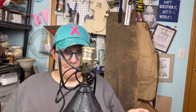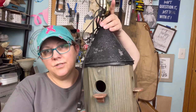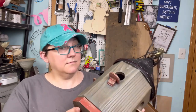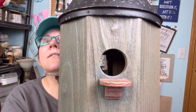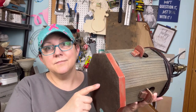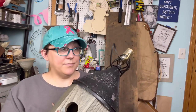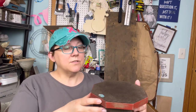Working on the lamp today! I picked this bad boy up at a garage sale for a dollar. If you're new here and haven't seen what I'm doing, the base is coming off. The seller said I could just glue it back on, but there's a threaded rod that runs through the middle of this — you can see it in there — which means there's a nut inside that's come loose and it's just barely hanging on. So I'm going to remove this and tighten it up properly.